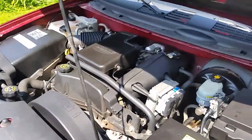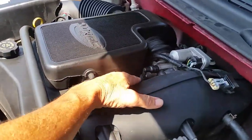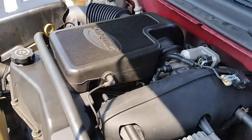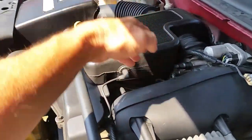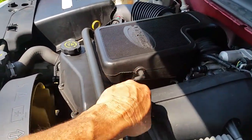That took care of it. And by the way, this is your PCV valve right here — your little elbow that goes down. Actually, I'm not sure it's a PCV valve; I'll have to check the owner's manual, but sometimes they stick them up here. Just check all these hoses right here, because this is where a lot of heat gets brought up from the engine and these can dry out and crack — and that's probably what happened to that one.